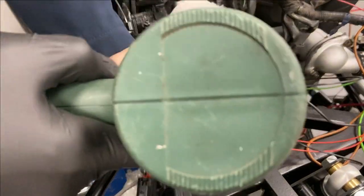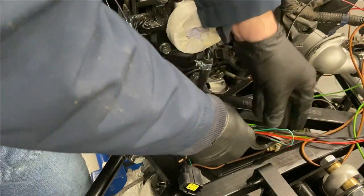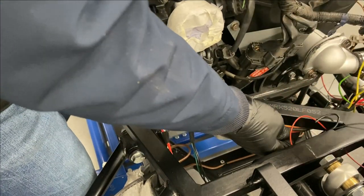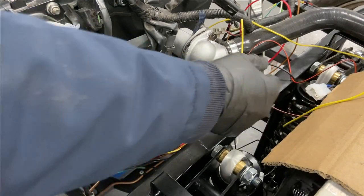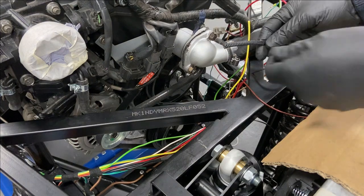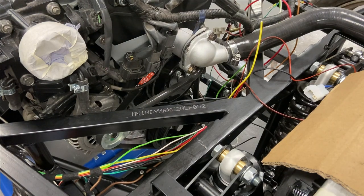All of this lot's going to sit inside split conduit, giving it that extra level of protection. I need a breakout - my black and my yellow wire. Let's take those two out. I'll cut them to length so that they can plug in there quite handsomely. What I haven't got at the moment is a two-way plug - I've only got a four-way. So I'm going to unpick that and put the two-way link in there. I'll put some of this sheathing over the end. I'm only doing this because it's a bit longer - I could put loom tape on it, there's several different ways of skinning a cat.